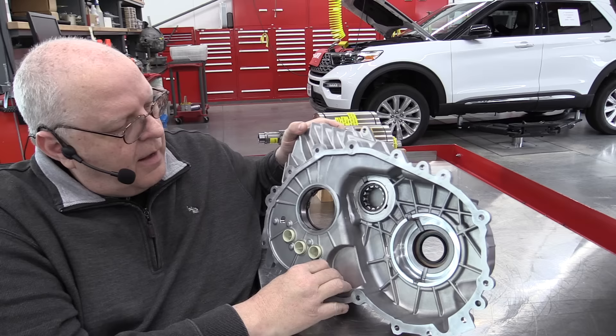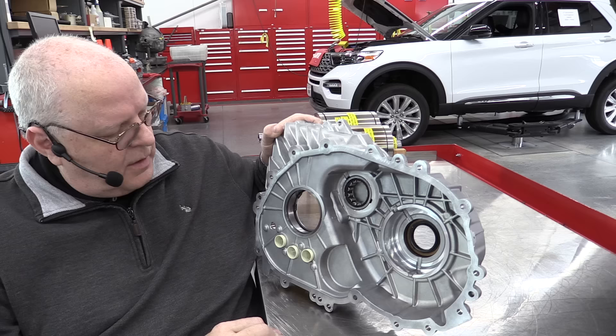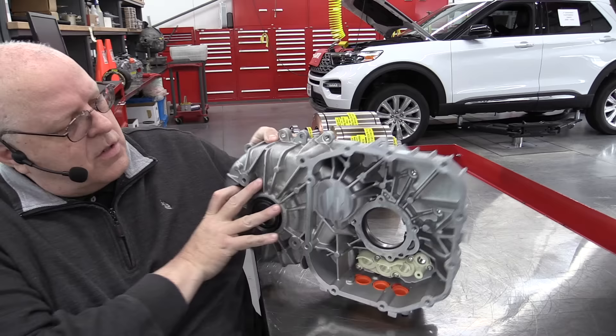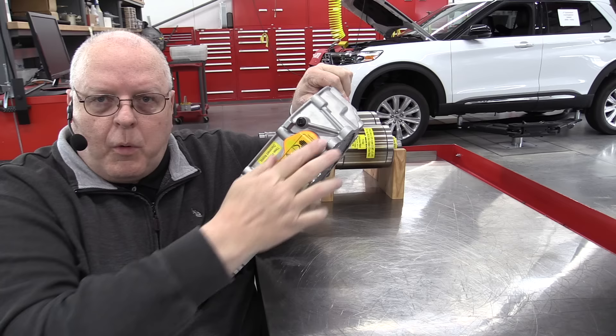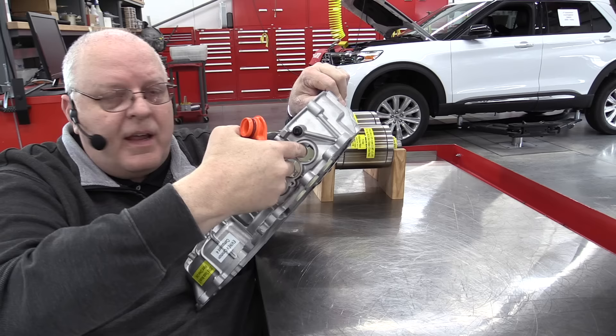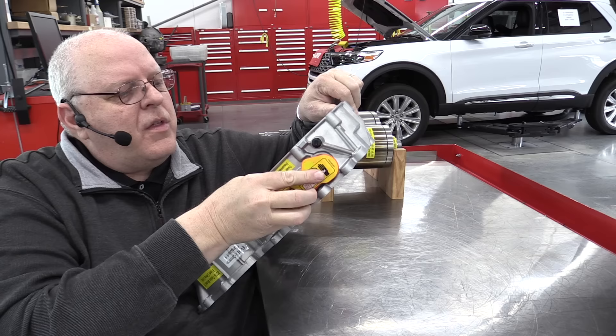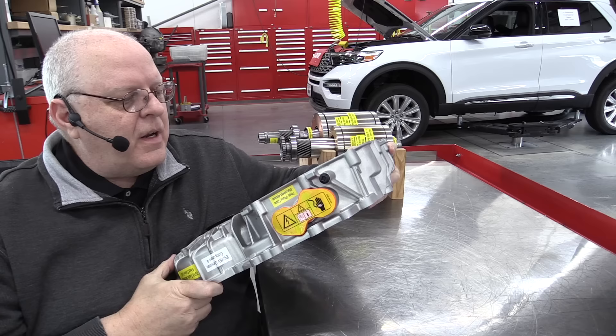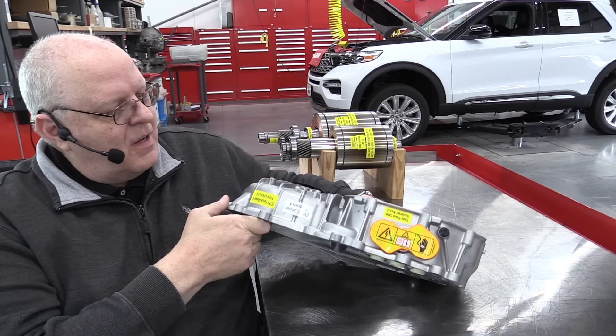The empty housing has a few things to look at. We've got places for three bearings, just like on the rear drive unit we looked at a few months ago. We have some holes here for the three-phase cables to go through from our stator to the inverter on this side. On the other side, this is where the inverter itself connects. There's a removable plug in the bottom of the case that lets you disconnect the cables from the inverter to the stator assembly. This plug is normally bolted down and has tamper-proof tape on the outside — if you try to peel that off, it'll show it has been removed, which may or may not affect your warranty status.